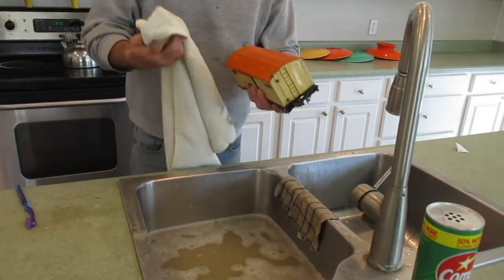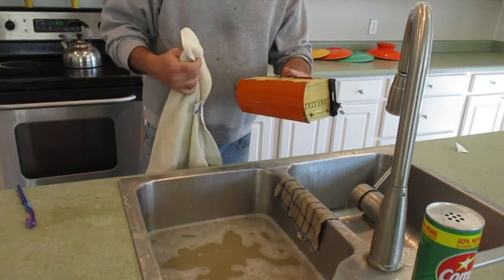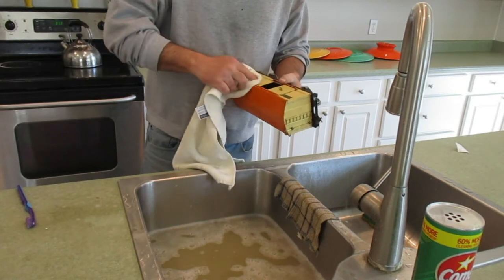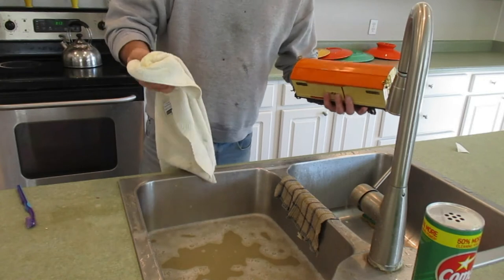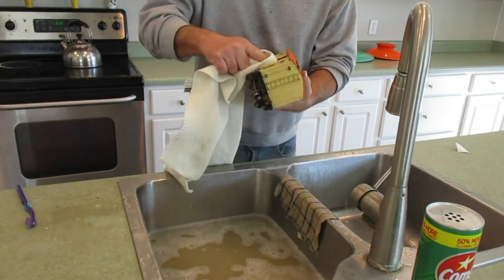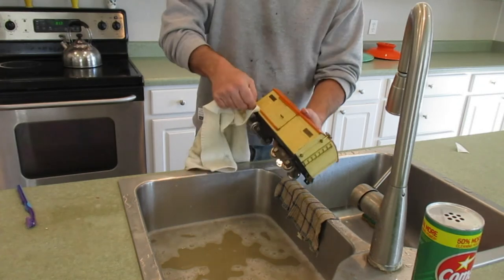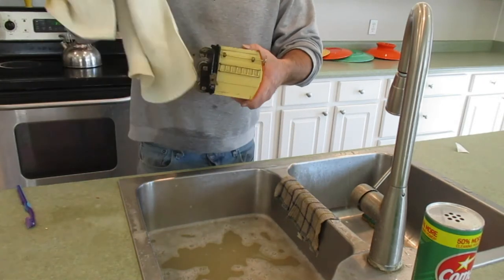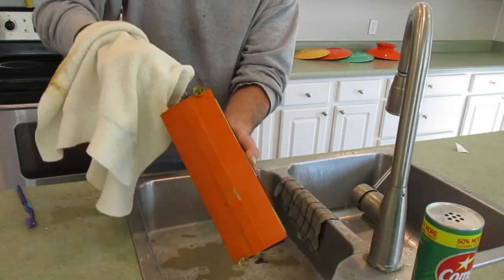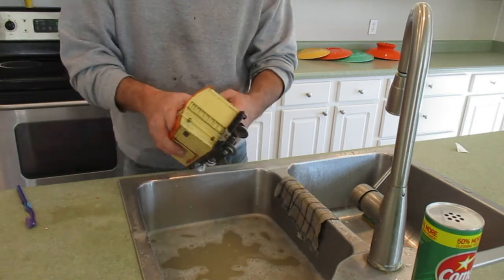When you wipe the car with a towel, you want a clean towel. I never use a towel that's been used when cleaning or working on things because I don't want solder fragments or metal pieces in it that will cause scratching. This is just a fresh towel — it's an old one but it's not something used in the garage where it has dirt or grit. Wipe off as much of this as I can. It looks better already — looks dull, but we'll put wax on it next.